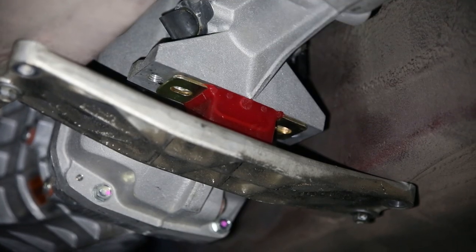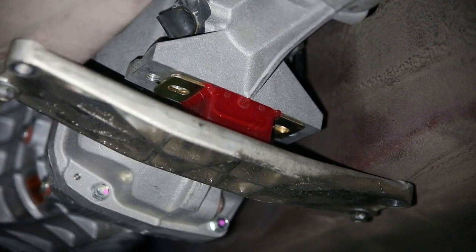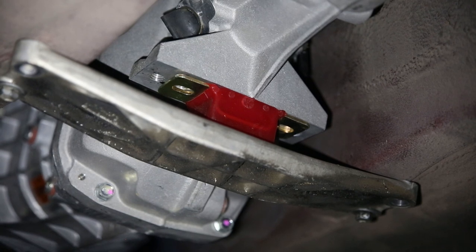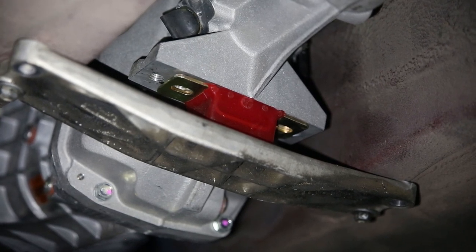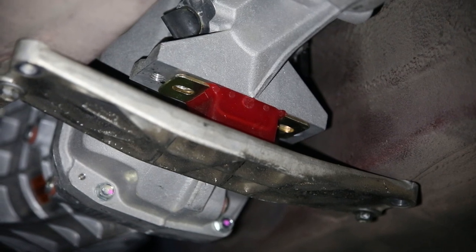And for the mount itself for the transmission right here, I'm actually just using an off-the-shelf Camaro Firebird transmission mount. It's a polyurethane one from, I believe, Energy Suspension. I'll put the part number in the description below.